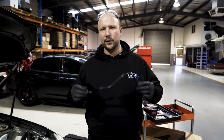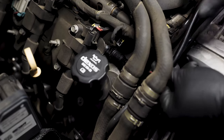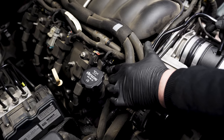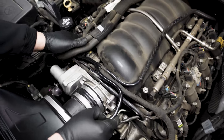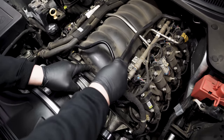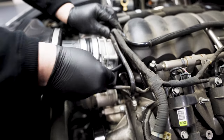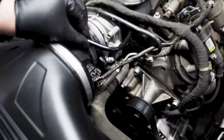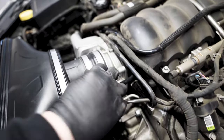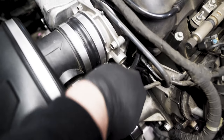The next step is to fit the PCV hose from the rocker cover to the throttle body reducer. Connect the PCV hose back to your rocker cover and tuck it underneath all the existing hoses so it's nice and neat. It's just a little bit longer so you can trim it and then route it back into your throttle body to MAF reducer.